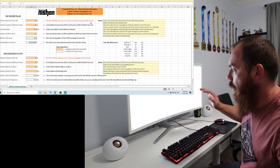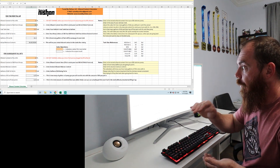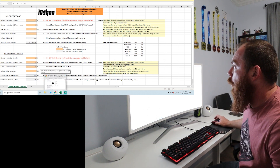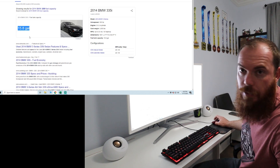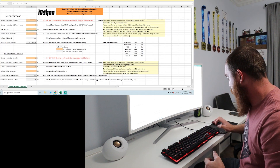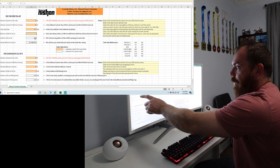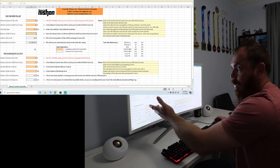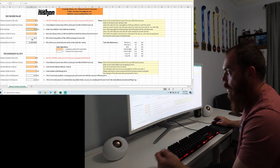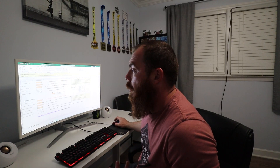10% is what we have here for the pump gas ethanol. We know we have E85 — our tester kit confirmed exactly 85%. Our fuel capacity for my 2014 335 is 15.8 gallons. So plugging in 15.8 gallons — if you put in five gallons of E85 you get 33%, and at 4.5 gallons you get 31%. So we're looking at about 4.3 gallons, which gives us 30.4% — that's our E30 blend.